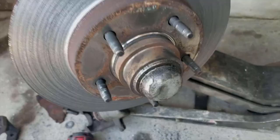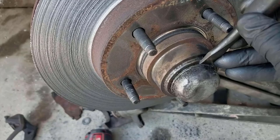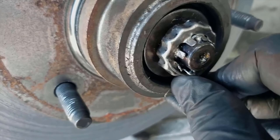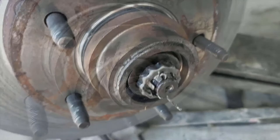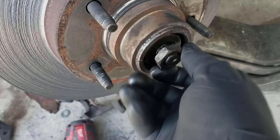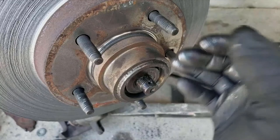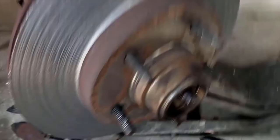With the bridge and the caliper out of the way, you're going to need to remove this dust shield, which I've already tapped loose. Basically you're just going to take a chisel of some kind, right in here, and tap it in until it comes loose, then it should pull out. With that out of the way, we're going to take this cotter key out by bending these tabs down and then pushing it back through. Then we're going to take this off — there's a nut behind it which we're going to remove. This nut actually isn't even tight or snug, which most of the time it's not. These are what's called packable bearings. This has a bearing on the outside and the inside. You pretty much only see this anymore on older cars and two-wheel drive pickups. Once this nut's out, if you shake this a little, this outer bearing will pop right out. It's a little dry but the wear doesn't look too bad.